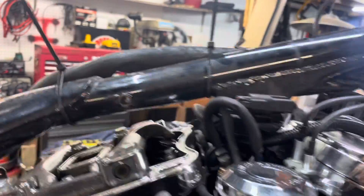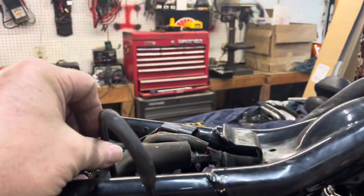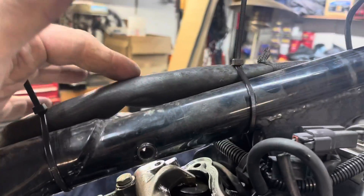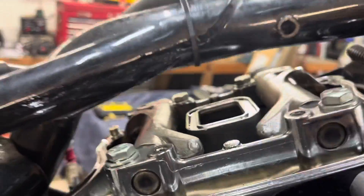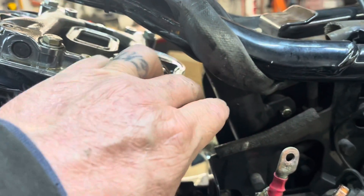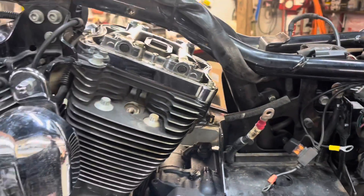I started without you. Basically I removed the tank, which is just the two bolts, the fuel line, and there's one little vacuum hose that's back here, and I just kind of tucked that stuff out of the way. This wire harness runs alongside, so I cut the factory zip tie so I can roll it up and put these zip ties on just so it's not hanging down in my workspace. I have also removed the battery because working in this area, the positive battery terminal is right there and there's a good chance of accidental arcing, so we want to avoid that whenever possible.